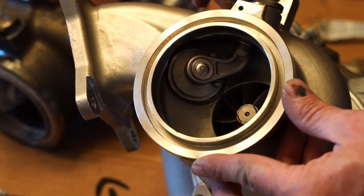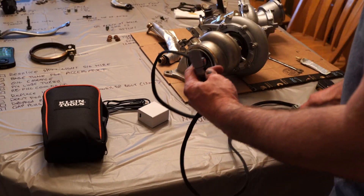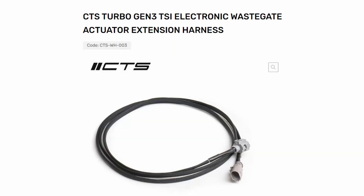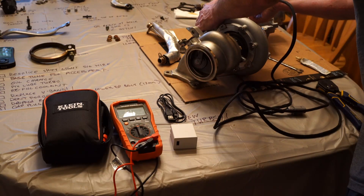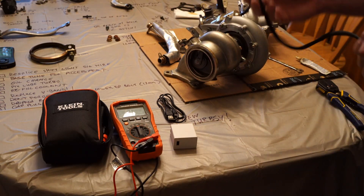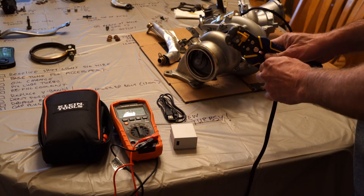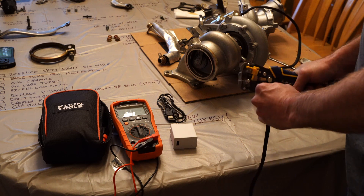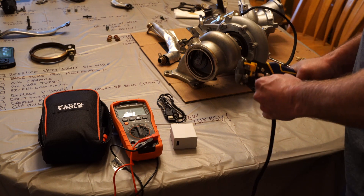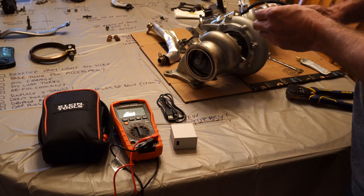I just initially set the wastegate until the flap was closed, and then we'll finish it with the multimeter. I have this cable from CTS Turbo — this is not necessary but it is helpful. I need a power source that puts out 5 volts, and I need a multimeter. This cable is designed to bench adjust an IS-38 actuator, which means you can do it without it being in the car. It's a long cable — you can just connect it up to the car, turn the ignition on, and get the opportunity to read the voltage. I'm going to use it as a way to connect to certain pins on the wastegate actuator.